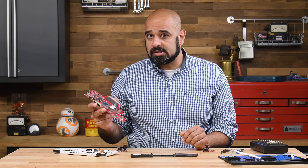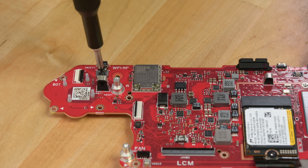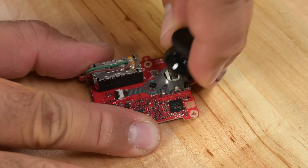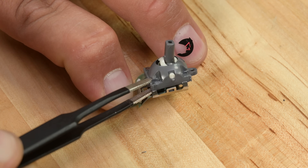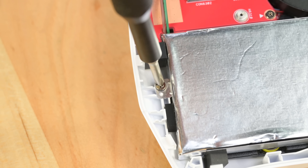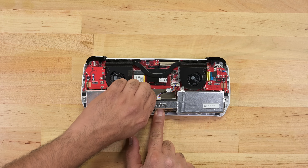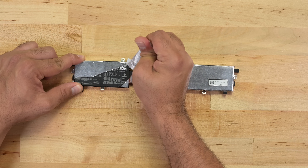ASUS has clearly learned from Valve's mistakes and made some minor but meaningful design improvements over the competition. The bumper buttons — one example of a failure point on the Steam Deck — have been reinforced here with both adhesive and a metal bracket. While drifting thumbsticks are a painless repair on the Steam Deck, the Ally takes repairability a step further by making the thumbsticks themselves modular, potentially saving the entire PCB. The biggest repair advantage of the Ally is its easily accessible battery — by far the most likely component to fail — and ASUS's engineers deserve a shout-out for prioritizing access to this component.